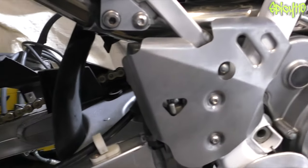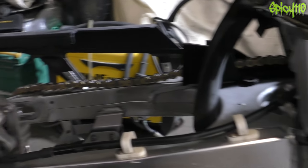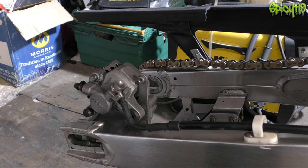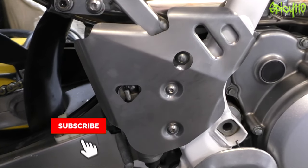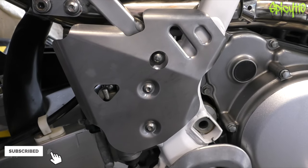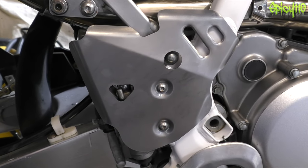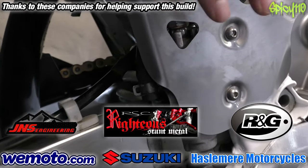That's also a 150 on there. However, as this bike likes to fight me the whole way, I have rebuilt and put new seals in the caliper on the rear because that had some problems. And then before I took the wheels off and I was just riding around town, I lost all pressure on my master cylinder. Thought maybe an air bubble was in there, bled it and bled it and bled it. So what it's going to be is the master cylinder itself — the seals will have gone in it, which is behind here.